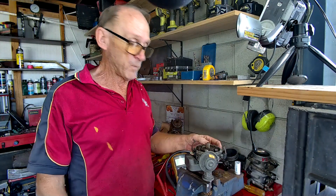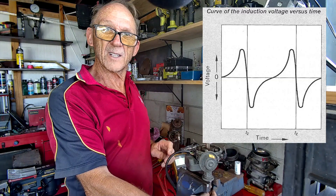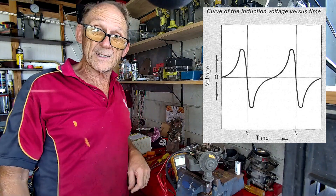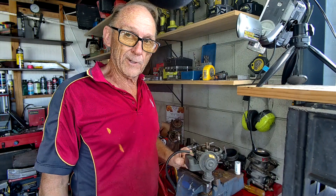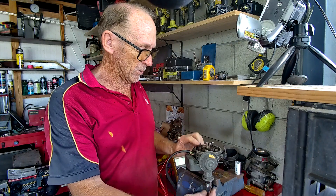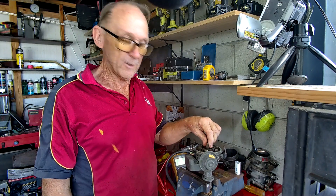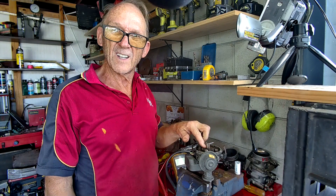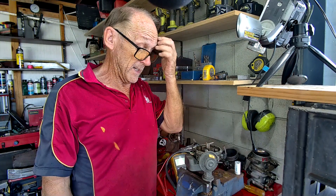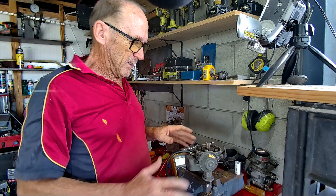That's why it's important to center this - so the module triggers ignition in the right spot with a good signal. I'll throw up a wave pattern we normally get when turning this by hand - mechanics will know what that wave pattern is. Be cautious of that clip - make sure you don't get it jammed in there or you will break that lug off. It can be repaired though - I've made a little pin to go in there, filed the guts of the trigger wheel out until it was round, and fitted a pin instead. But all that costs money if you get a professional to do it.